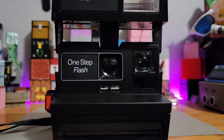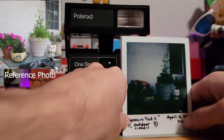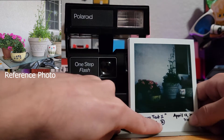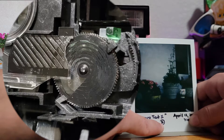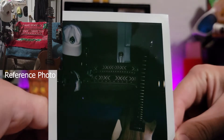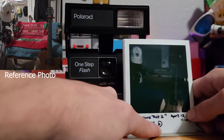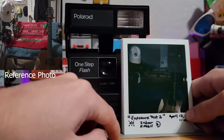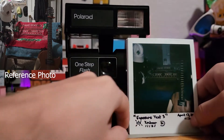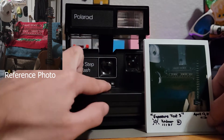Before finding this article I tried to fix it on my own, and these were the results. In the first exposure test you can see it's underexposed, using the stock setting with the exposure in the middle. After moving the dial to two — allowing less light through with the flash on while being outdoors — the second test, an indoor shot with the same internal setting of two, was again underexposed even with the flash. In the third shot it's a little more exposed; same indoor shot but with the slider set about halfway to a brighter setting.